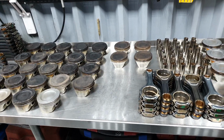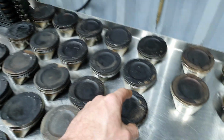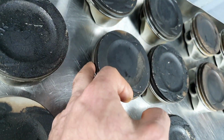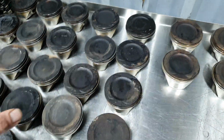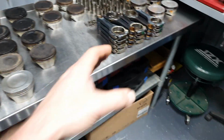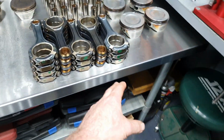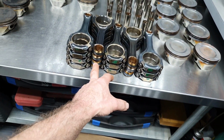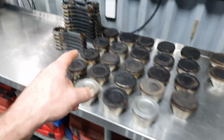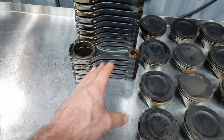This. Now, what's the funny thing? Like I said, I keep the piston connecting rods that I can see carbon at this point and carbon from this point. Let us say east and west on the piston. Now, I found some healthy connecting rods that are straight. These are the straight connecting rods. We have 3, 6, 9, and 4, 13, and 4, 17. 17 connecting rods, they're straight. All the rest are bent. This is slightly bent, and this is bent.